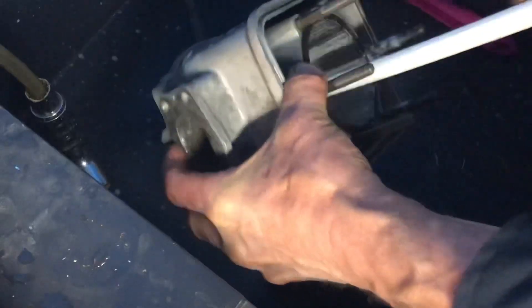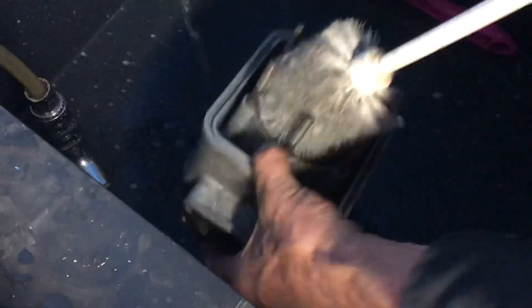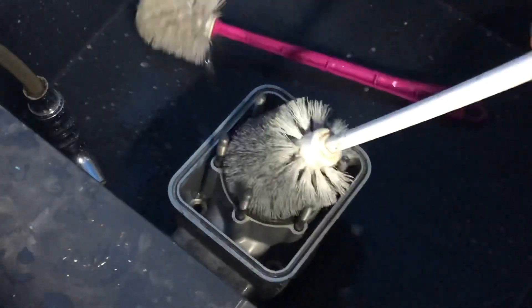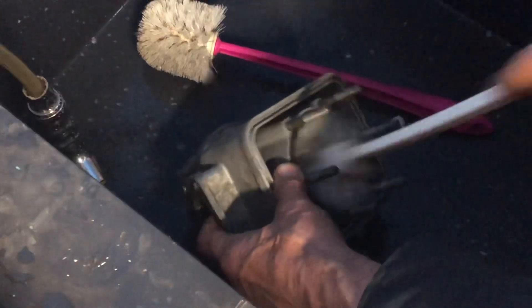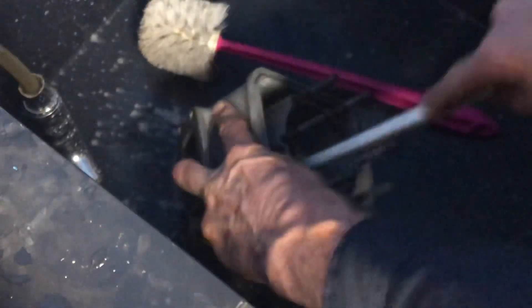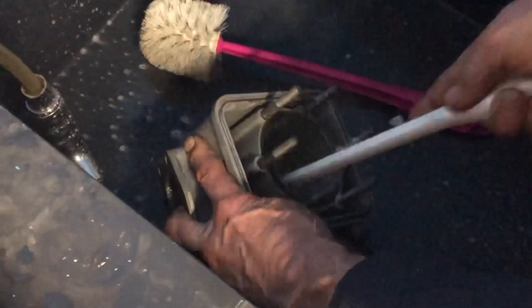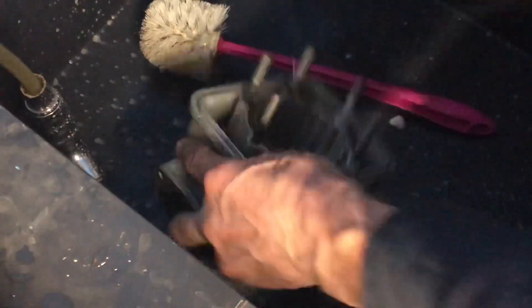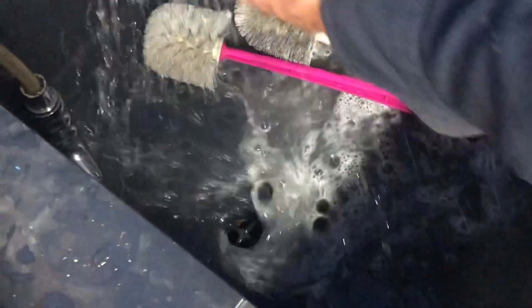So lots of soapy water. What am I using to do this? It's actually a toilet brush. I have a nice colored one that's smaller for 503s and the larger white one for the 582s. I'm trying to get right into all the grooves from the new honing to get all the debris out. Give it a rinse and we'll dry it off.